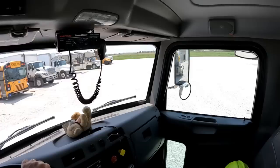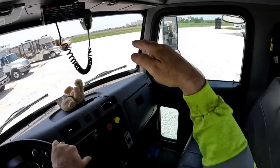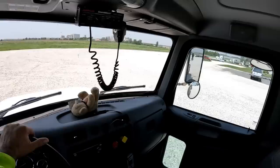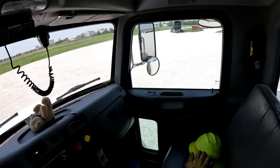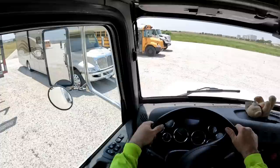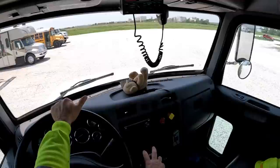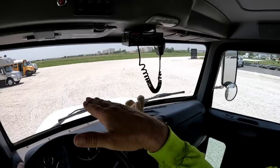I don't want to push this truck onto the trailer because of the breakover of the ramp. Plus, I don't want to overload the ramps. I don't know what his ramps are rated at. Don't want to risk overloading them. So I've done this before with ramps, and a lot of times, if you have too much of a slope, it wants to hit the underreach whenever you break over.